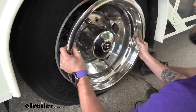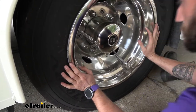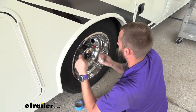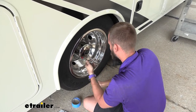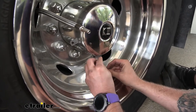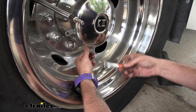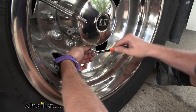We can go ahead and pop our cover back on, lug nuts back on as well — kind of help pop it back into place. I'm going to go ahead and just tighten those down, just until they're snug. Now we can go ahead and just feed in our hoses and take our little nuts and start tightening those down. Then you can take a 3/8 socket or wrench and fully tighten it down — it doesn't have to be super tight, just enough to make sure that it's not going to come off.